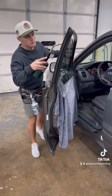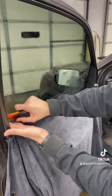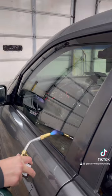I take my torch, apply a little bit of heat to the top edge, roll the window up, and then begin the second stage of the two-stage method. When all the clean soapy water is pushed out of the bottom half of the window tint, I take my hard card and paper towel and dry the bottom edge so that no fingers will pop up.